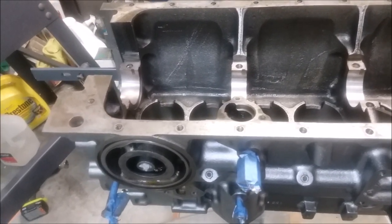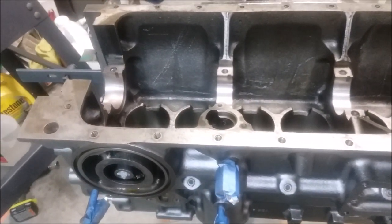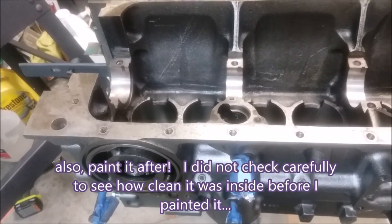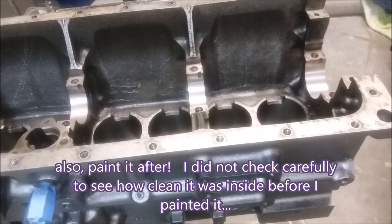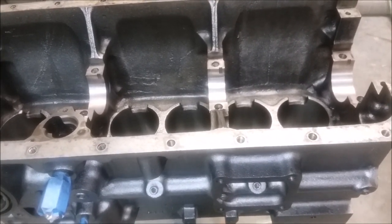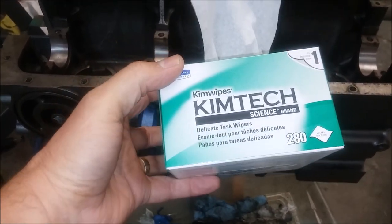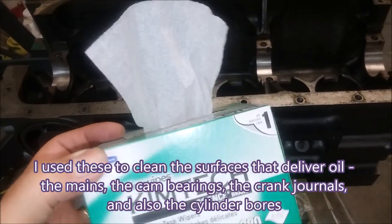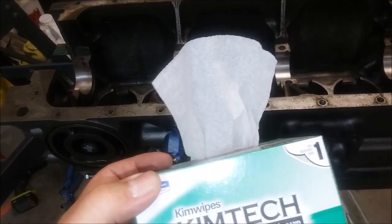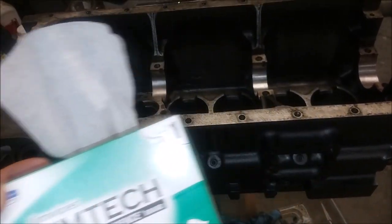The engine is as clean as I can get it. It took me 10 to 15 hours to clean all the hardened crud off. The lesson is: be very careful with your machine shop and understand how that engine is going to come back. If they're using modern water spray methods, it's not going to come back truly clean. For a final wipe-down before assembly, I'm using lint-free Kim-tech tissues — 280 sheets from Walmart — along with brake clean and then PB Blaster to oil-coat the surfaces.